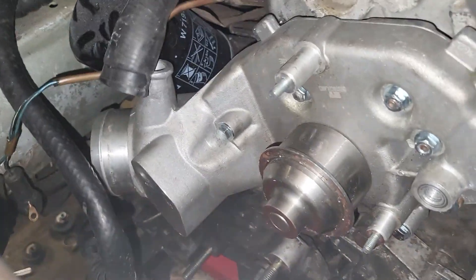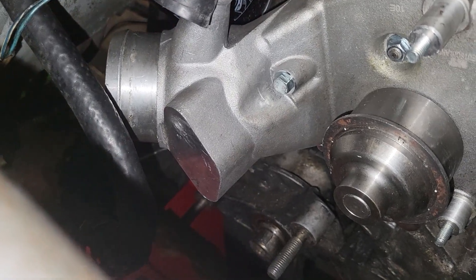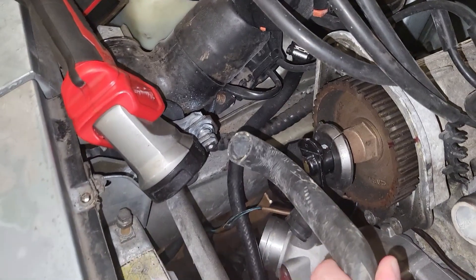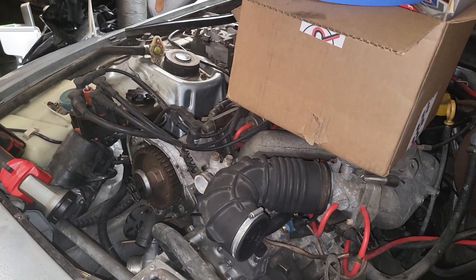The first one is a naturally aspirated water pump. The most identifying mark is that plate — there's nothing there. You will notice it's an ACAR, and you will see this hose, which goes into the radiator. That port will be blocked off on any of the turbo or late model pumps.